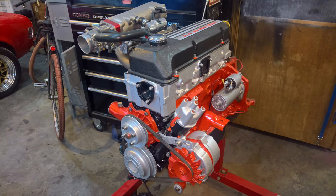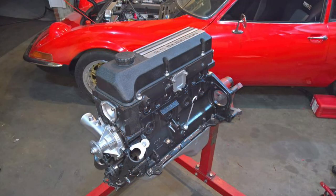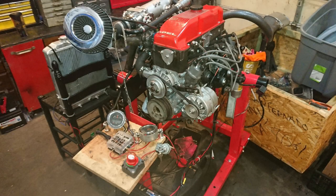One of the things I've learned is that back when building these motors, some would give me 140 compression, some would give me 180, and usually the problem children — like the 2.5 motor prototype — would be running 205, 210 compression. What's really interesting is that you generically cannot correlate the compression test results with actual compression ratio. There's a lot more in play: your cam opening position and a lot of other stuff.